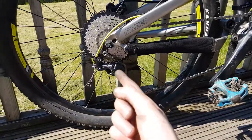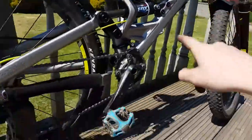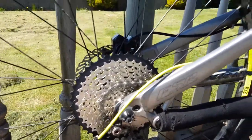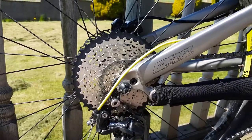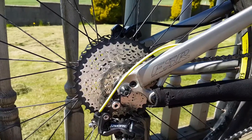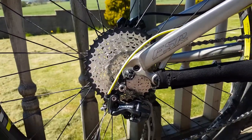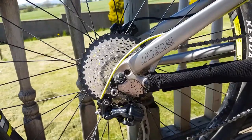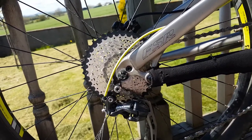The reason I have to take the chain off with the derailleur in this gear is I'm running a 9-speed derailleur, 9-speed shifter, and 9-speed chain on a 10-speed cassette. I was going to get a 9-speed cassette but the biggest I could get was a 36-tooth, whereas this one is a 42. So it wasn't worth it. I'd rather get something significantly better than just a minor improvement.